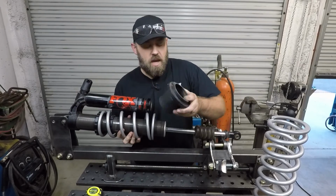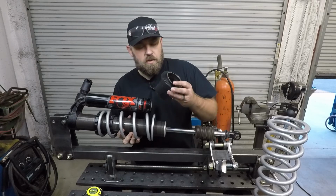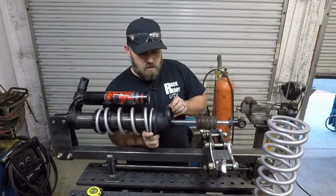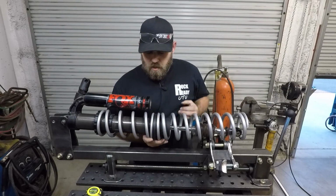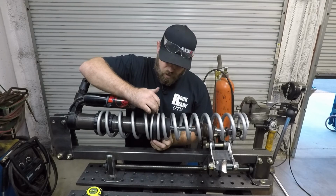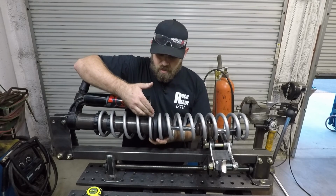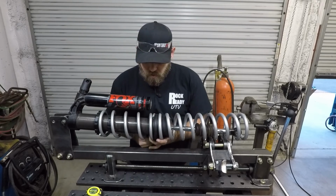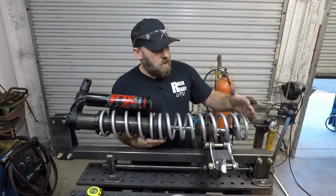After that, you need to take your collar. Make sure you put a spring adapter on there. Slide another spring adapter on the other side. Then I can put my main spring on. Now at this point, I'm going to go ahead and start getting the ends of the springs lined up with the arrows on this collar right here. Remember, I'm placing the ends of these springs so that they're 180 degrees, the end of this spring in relation to the bottom spring.